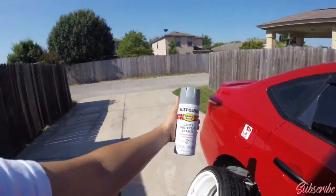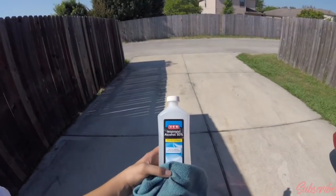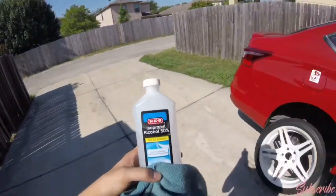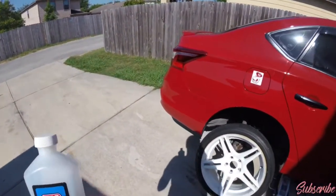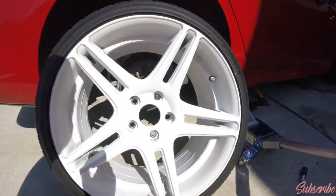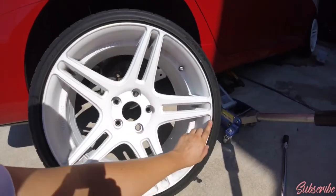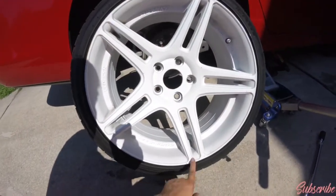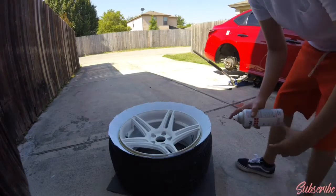Let's see how they turn out — I think it's gonna look pretty sick. Before you get to painting, you want to grab some rubbing alcohol and a clean rag. Rub it around the wheel just so you can get it free of any grease. Because if the wheel or whatever you're gonna paint is greasy, the paint's not gonna stick well and it's gonna bubble and be wrinkly. Let's get to it — let's get the first coat going.